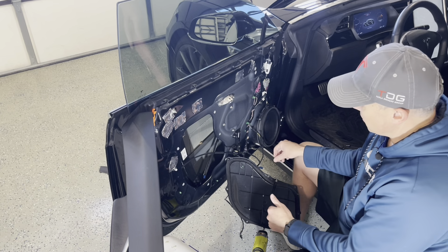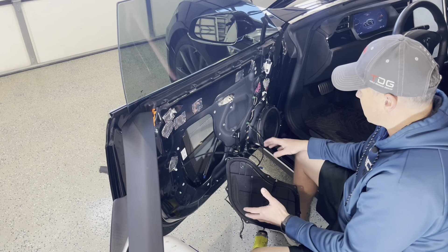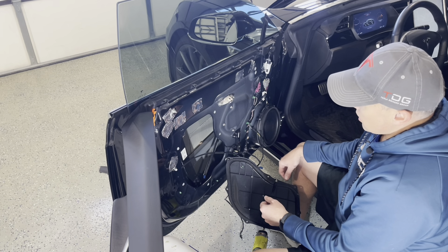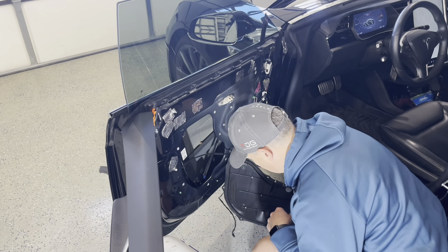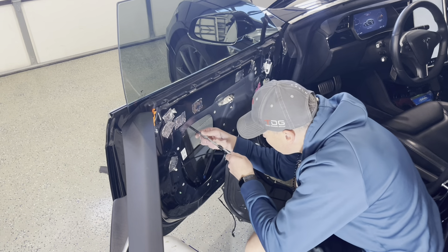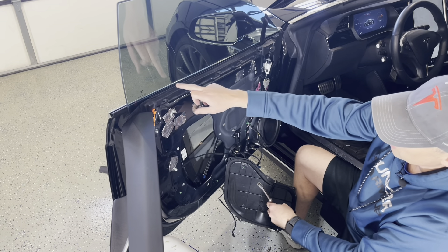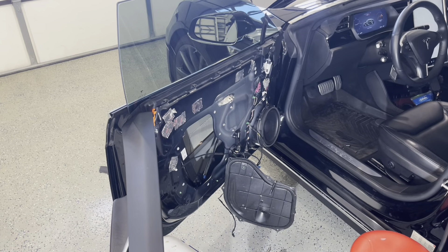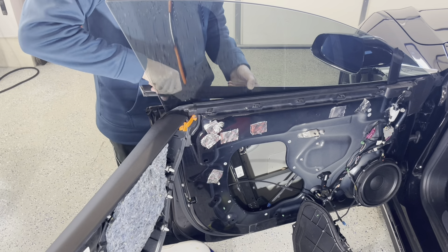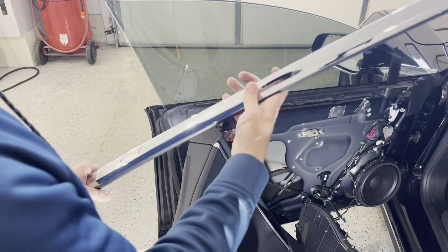Now that I took that off I can really hear the motor humming. There's a little connector at the bottom of the door handle assembly — you can disconnect it to cut power to it so it stops running. It will never stop running on its own. My rear passenger one probably ran for a week before I got the parts. There are three or four bolts holding this assembly in — they look like 10 millimeters. One of them is at the very top, and you have to take off this top trim on the window to get to it.